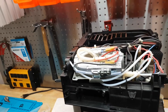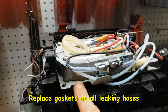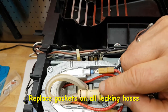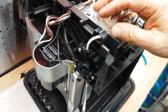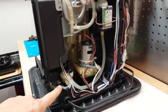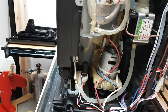This is the heating element and I always had water coming out right here at this crack. There was always wet and a little puddle. Then down here at this hose it was dripping. Back here I'm going to replace those gaskets — I've done this one before. Down here it was always wet. Up here there is also another hose which hasn't caused too much problems yet. And then down here is the flow meter — that's the thing you've got to fix when you get faulty warning lights about your water level.